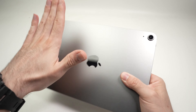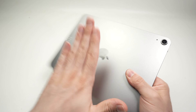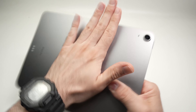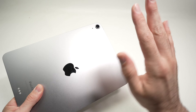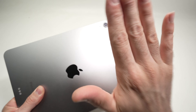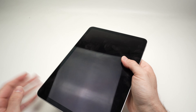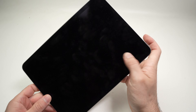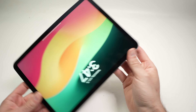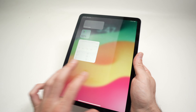You're going to work your taps upwards like this. Same thing in the middle. And on the sides as well — give it a good tap with the palm of your hand. We're simply trying to reconnect whatever was disconnected in your iPad. Afterwards you can try it out and see if the screen is now responding to your touch.